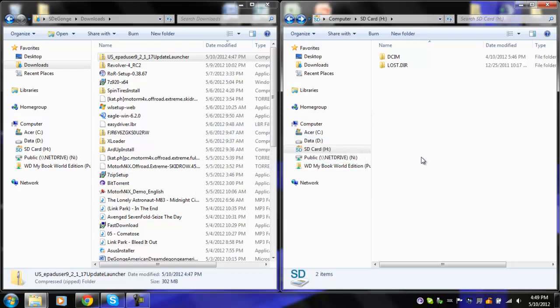Then what you're going to do is turn on your Transformer, make sure it's awake, and plug in your SD card with the update file. Once you do that, in the bottom right-hand corner of your device there will be a little triangle with an exclamation point and it'll say System Update File Detected. You're going to touch that. It's going to say select the update package — just hit OK. It'll say you have to have some battery life left — hit OK again. And then it will power off and start updating. That's all that you have to do. Once this is done updating, you will be on the almost most recent firmware update.